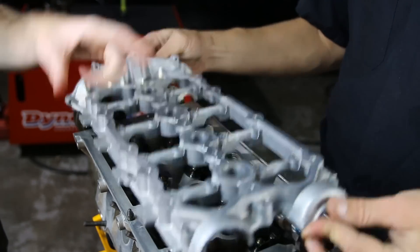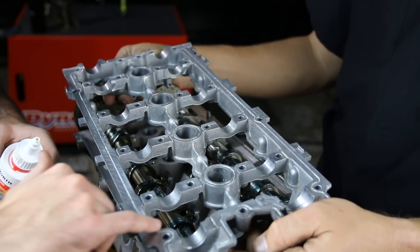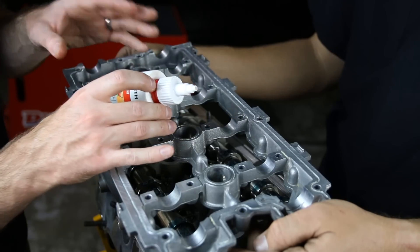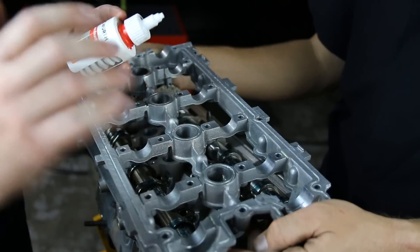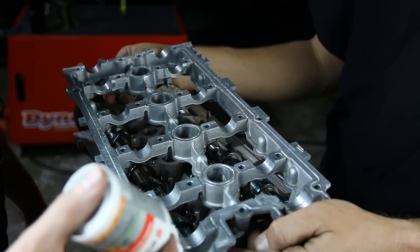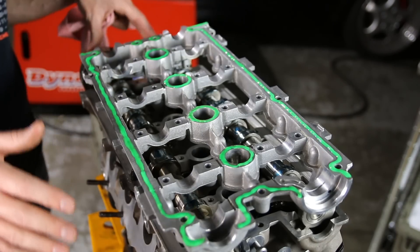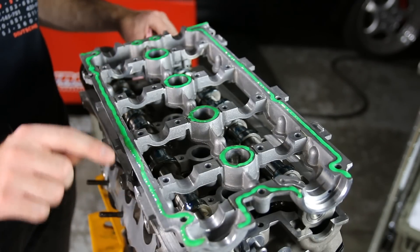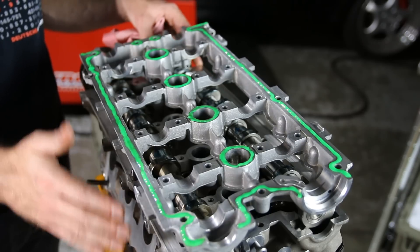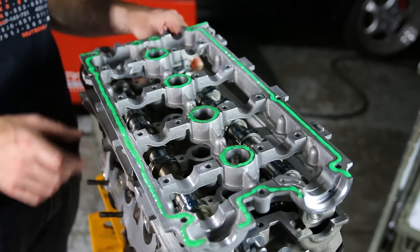Now we're going to be installing our cam cradle. You can see it mounts like this, but we've got to flip it over so that we can take our flange sealant and put it in place. We're going to be installing it in these channels here. We have this specific anaerobic sealant — what that means is that this sealant will not dry in the presence of air. This stuff is super expensive; the factory stuff is around $100 for the tube. This is a little better priced, so we'll have links in the description. When you flip this over, it's never actually going to dry because it's anaerobic. Any excess you're just going to wipe off, because this type of sealant will never dry in air — only the part captured in the actual seal section, which is free from all oxygen, will dry.